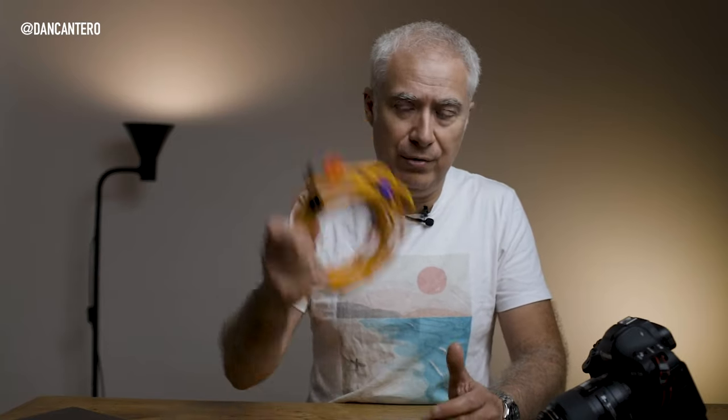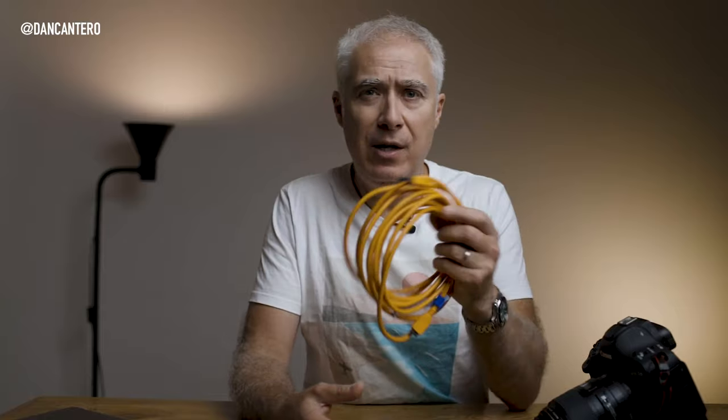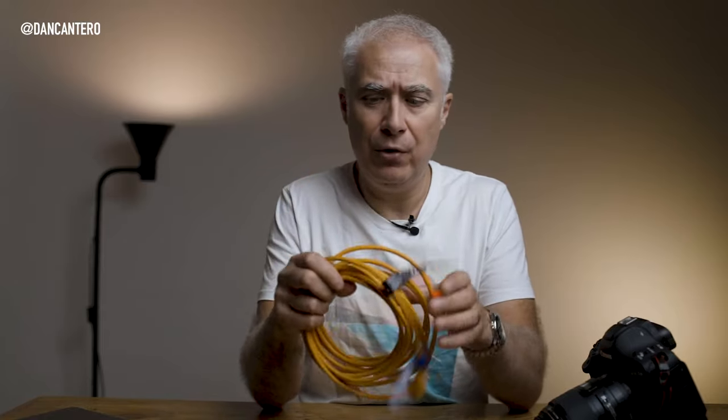So what do you need in order to do this? I'm going to show you how to do this using a USB cable. There are other methods to connect — a lot of wireless systems are coming onto the market now, which are very good — but in order to keep things simple, I'm going to use a USB cable. This is a Tether Tools cable, specially designed for connecting cameras to computers, but you can use just a generic cable like a hard drive cable and it should work fine. Where you may run into problems is where you're getting a cable that's too long — anything beyond three meters, which is about nine feet — sometimes you might get dropouts. Cables such as these are designed for this sort of thing and they're really reliable, but you don't need one. A three meter generic cable should work fine.